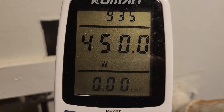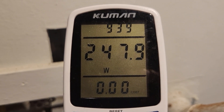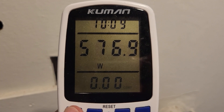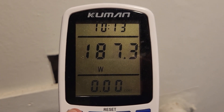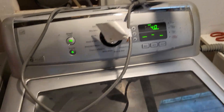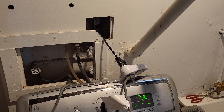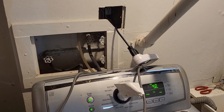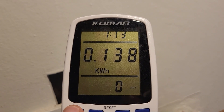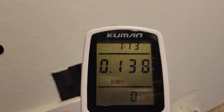Now it's really getting going — 450, 247. This does seem like an improvement in the spin; it just feels more vigorous. I'm seeing 350, 576, 180. In my opinion this needs the amount of power that comes from 120, not 110, so I probably can't wash from the EB120. Washing is done — it took a total of 140 watt hours. Wash clothes for less than 200 watt hours — nice.